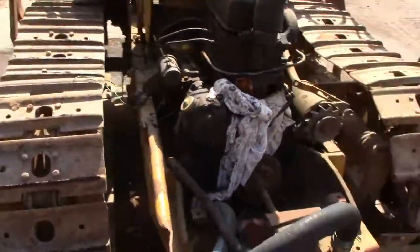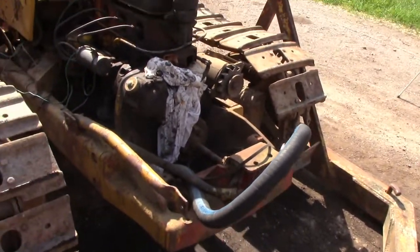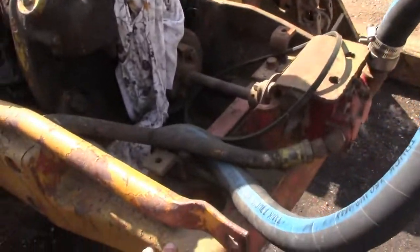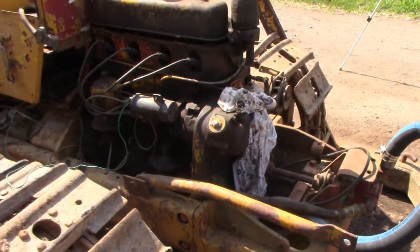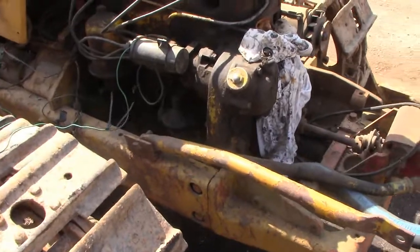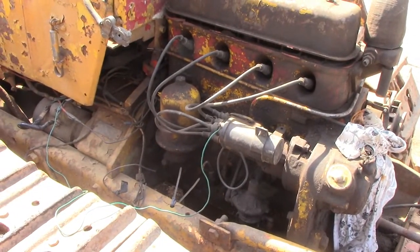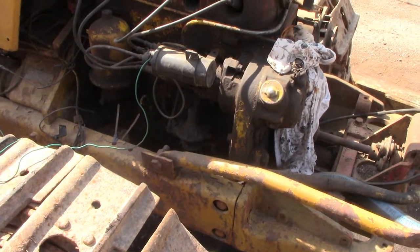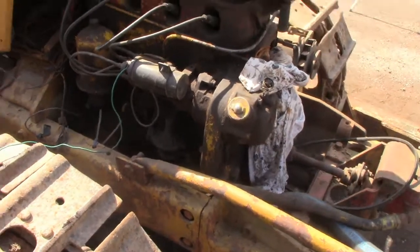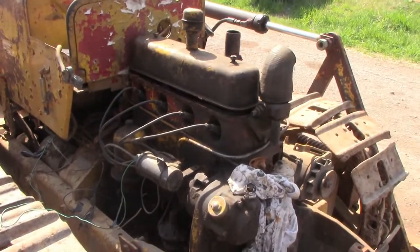We'll have to take out the pump drive shaft, and that front casting here comes off out of the rails, and then the engine just unbolts with four bolts at the bell housing in there. And so from there we should be able to see what's going on. So I'll get the camera set up and we'll start getting bits and pieces off here to get a motor out.